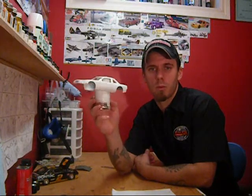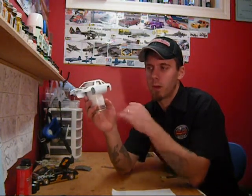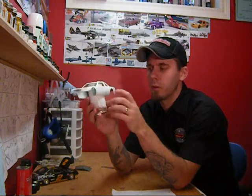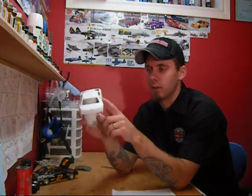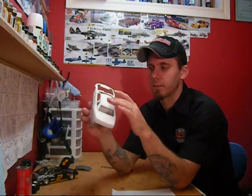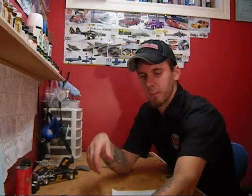This has been primed, one coat of primer, wet sanded with 1200 and then 2000. I burned a couple of little holes in the primer, so I went back, sprayed again, clear coat, and wet sanded again. It turned out very smooth, almost like silk. I think it's ready to go. This is going to be the experiment.